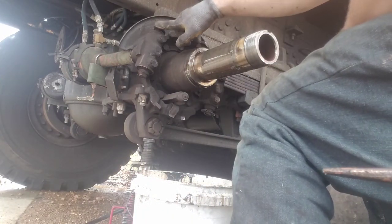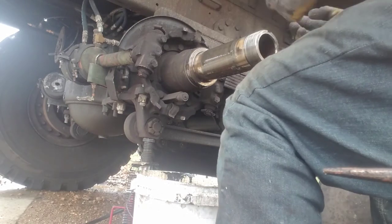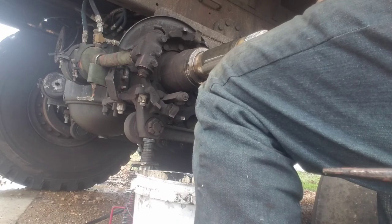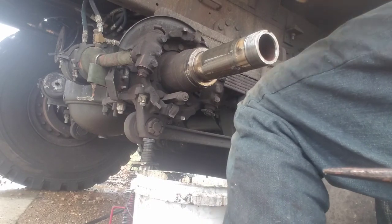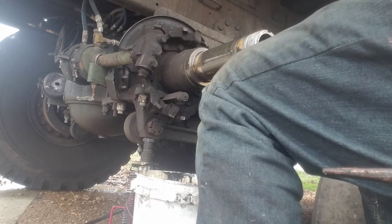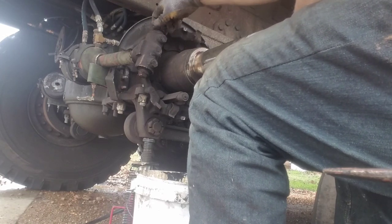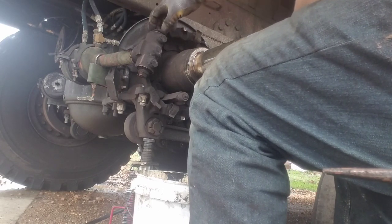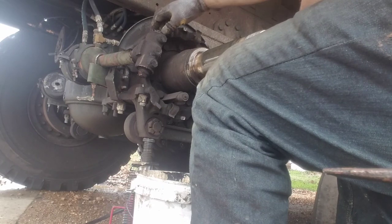You got two adjusters — one here that's gonna be in the bottom. You got your spider and backplate. You can buy the old spider if you want — they're about 108 dollars from a parts supplier; they won't have brake shoes on them. You got this little adjuster that turns in and out. Some folks take them apart and degrease them — just turn it back down clockwise on the back one until you reach the bottom, then go back a quarter turn. You're gonna feel a tightness.